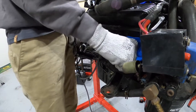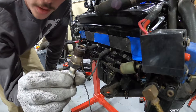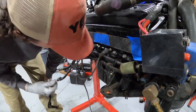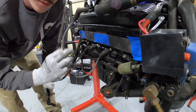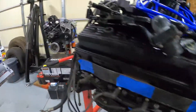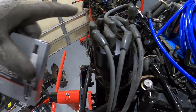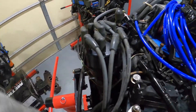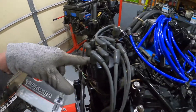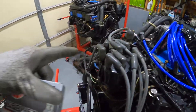You should be able to get the old plugs out with your fingers after loosening them. They're a little warm and dirty with some carbon buildup — that's why you change your spark plugs. Pull that guy out, put the new one in, and find the correct length wire. By the way, I just realized I've got new distributor caps, so I'm not going to replace the spark plug wires until I do the distributor cap first. I'll get all the new spark plugs in, then go wire by wire after I get the new distributor cap on, transferring it all over.